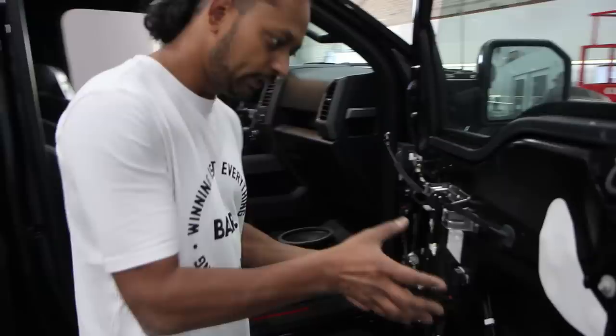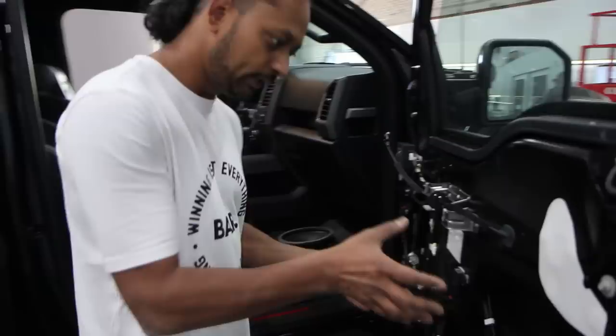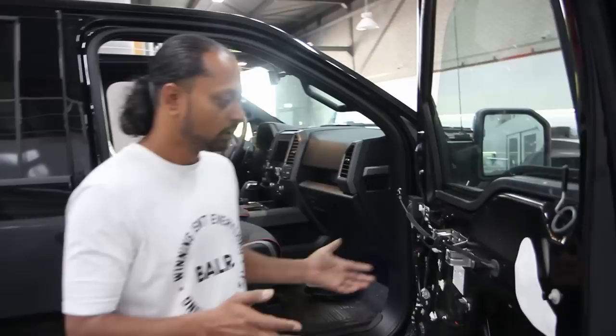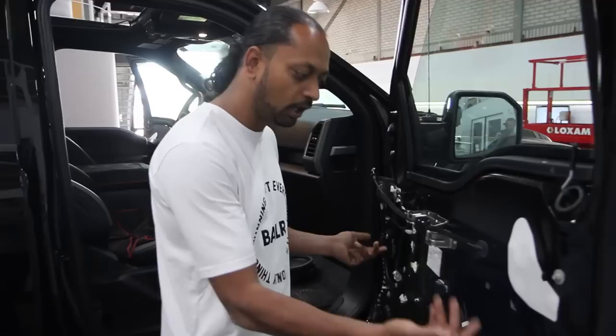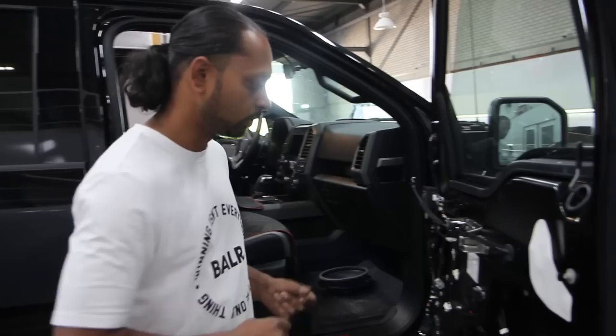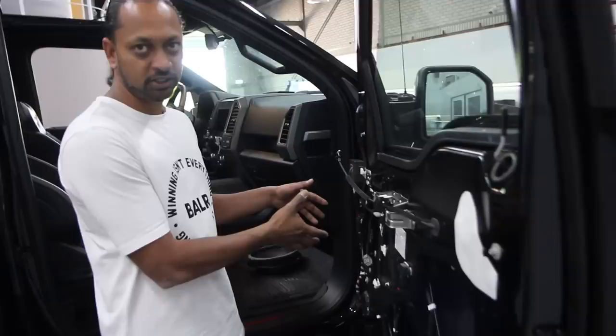What we came up with is to make a one-centimeter thick ABS plate, exactly curved and shaped to fit perfectly. We glue that with a special glue which they normally use to glue the front window into the car. So it will be very solid. If in the future the window needs to be changed, it is possible to cut the glue loose, remove the panel, and access the bolt. It will not be a ten-minute job, but it is possible. Then we cover it with the soundproofing materials as well. In that case we have a huge enclosure for probably an 8-inch mid-bass speaker, and there will be horn-loaded tweeters in there.